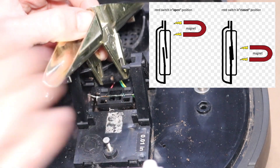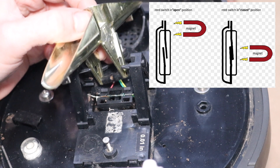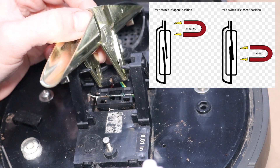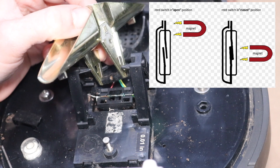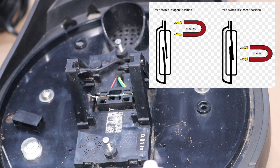The magnet will pull those two contacts in contact with one another, therefore temporarily closing the circuit, creating some resistance. That'll send a signal to the computer. And then based on the number of tips, that will indicate as to how much rain has fallen.